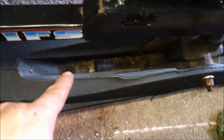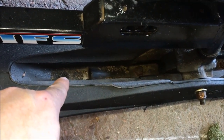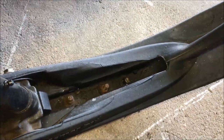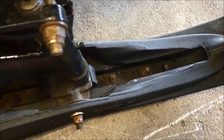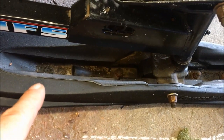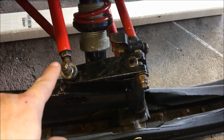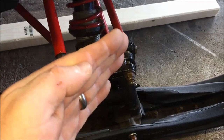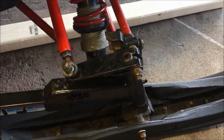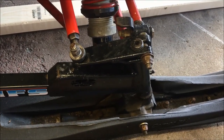On these particular skis, because we don't have a straight edge on either side, we're going to do it a different way. We're going to measure from the center line of the carbide. There are a couple of spots on the skis that, while not used, are still on the center line, and we're going to go off those in the front. Using those two dimensions, you figure out what they are, then split the difference and make the adjustment by loosening the tie rod end and twisting it in or out to make the ski go in or out.